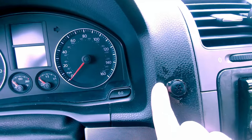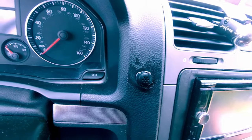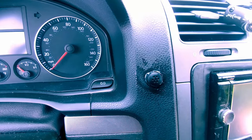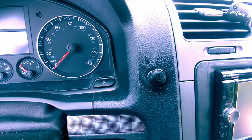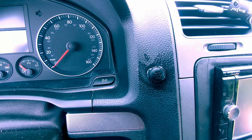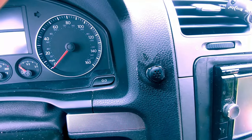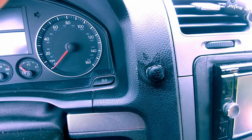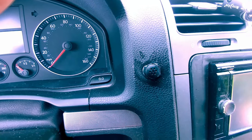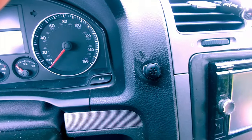I know a lot of people might think this is unsightly — drilling through your dash — but it's my car, it's paid for, and I've had it since early 2006, a 2005 model MK5. It's been great with very few issues. Now obviously think logically through things: your cluster panel is close by, you have wires through there, you have airbags. You don't want to drill through your dash in a spot that's going to chew up something important. With this removed, I knew this area was empty because I could reach my hand in and feel open space. I drilled a small hole through the plastic — there was a plastic cavity about half an inch in — and drilled through to get into the open hollow space.